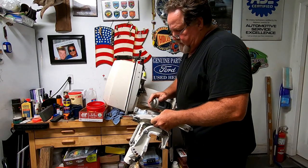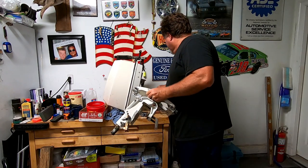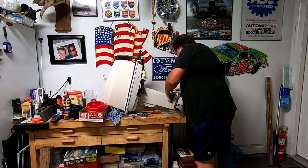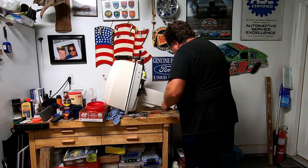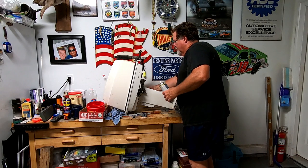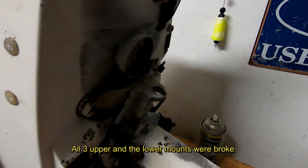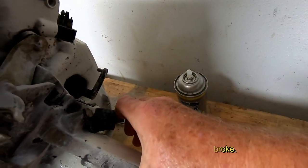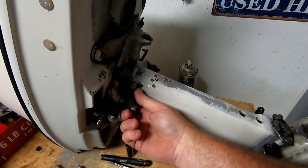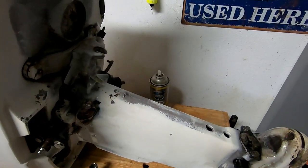You can see it's highly corroded, so we'll blast it a little bit and let it soak. Get to these two lower ones again. Look — this side mount's broke. Both of the motor mounts are broke. If you take a look at this, all three of the upper motor mounts are broke. They do that over time, they go bad.